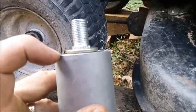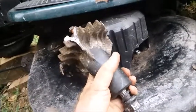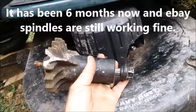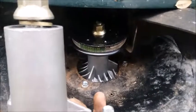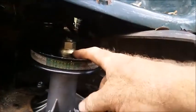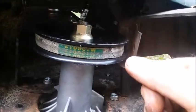When looking for your new spindle, you'll notice that Sears Parts Direct prices are about four times as much as on eBay. We chose to try the eBay option - got two spindles, two blades, two pulleys, and a belt for about $55. These are probably cheap Chinese parts but it's an old mower so it only has so much life left in it. I did notice the bearing seemed awfully loose on the shaft inside the spindle, but after getting the nut really tight on top of the pulley there didn't appear to be any play - tightening the nut down appears to lock the spindle bearing so it's not sliding up and down on the shaft.